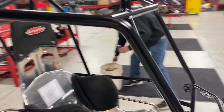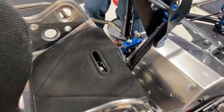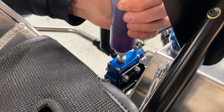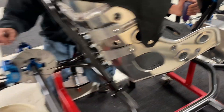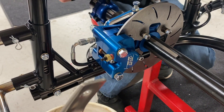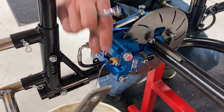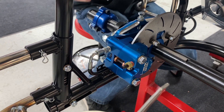We'll fill up this bottle full of DOT 5 brake fluid and then head to the car. Get a waste bucket because you'll be removing excess fluid as we bleed it. We'll take the bottle, flip it over onto the nipple, and apply pressure to the bottle as we bleed air out of the rear screw. With the bleeder screw open, squeeze the bottle to run fluid through the line. Once we get a steady stream with no air, we tighten it up and relieve pressure from the bottle.